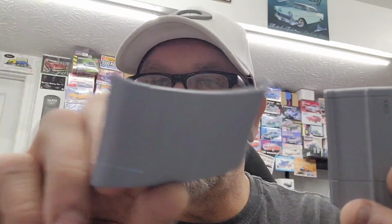Yeah, everything's final primer, guys. We're golden. We'll do our final sanding. We'll give it a good wash, let it dry really good, blow it off. We'll de-static it, or whatever the word would be. We don't want any static electricity on it when we go to paint. And then we'll mix up our colors.